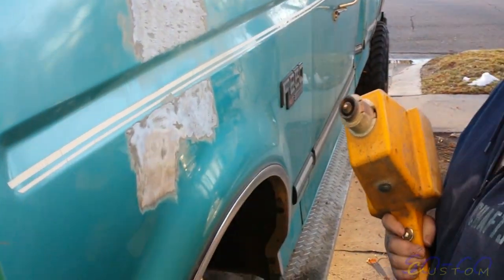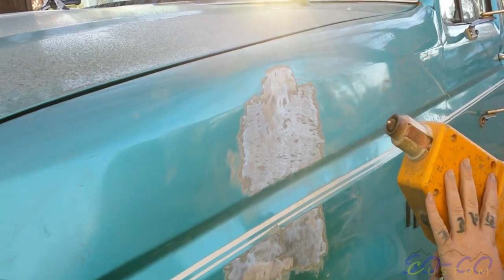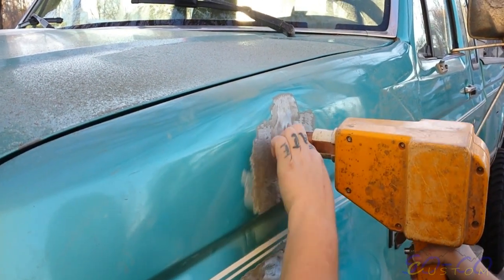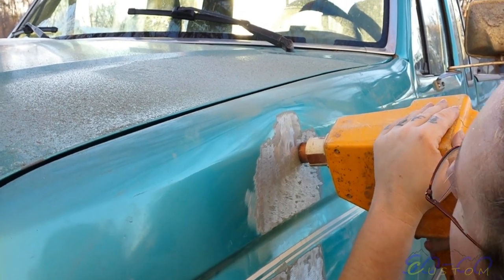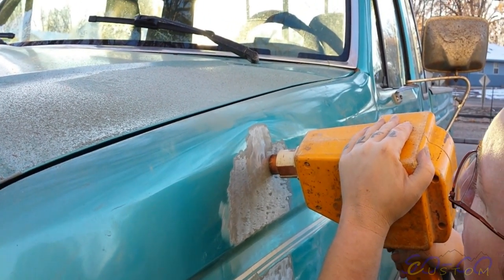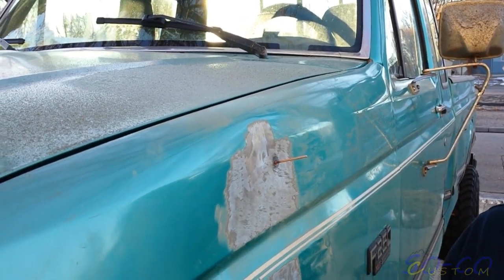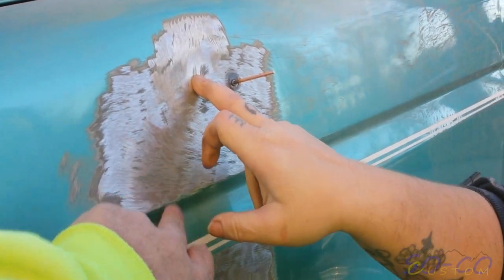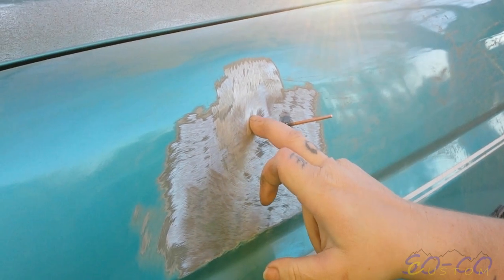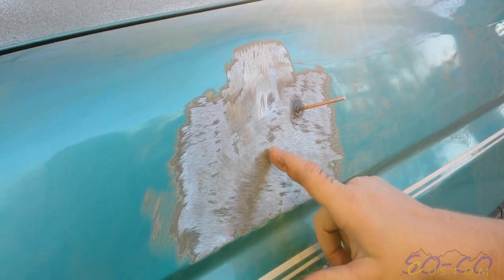Okay, babe, so you put the flat side in there. And then you'll hold it flat against there on your low spots. You'll need a few of them. You'll stick them wherever it's low. You'll hold it flush against there for about 3 to 5 seconds. And that's it. Then you just continue putting them wherever there's a low spot. Like here, I would put one right in the middle. And then you can just space them. Then we'll start pulling.